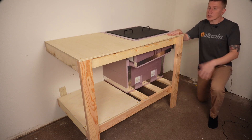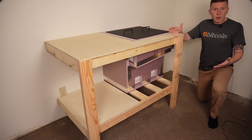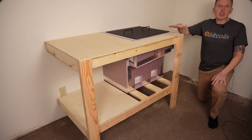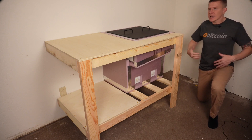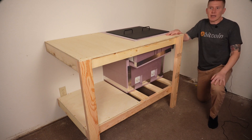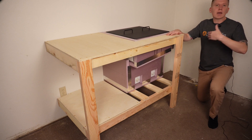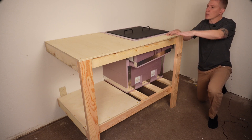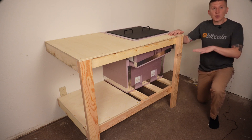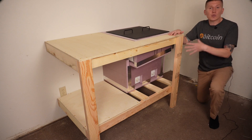Here's what I built — a very simple shelving system from 2x4, 1x4, and plywood, about 4 feet wide and about 36 inches tall. This holds the tank off the ground and gives me a lot of extra room to route lines. It also puts the top of the tank at a good working distance so I'm not leaning over as far when moving miners in and out. I also have extra shelving room — you can never have too much shelving. This gives me space for empty Bitcool containers and a good working platform to service miners. If I have to take a miner out of the fluid, I can put a piece of plastic on that plywood and drain the fluid back into the tank. The tank outlets and inlets are facing outward, giving me really good access to them for building the piping system and chasing any leaks.